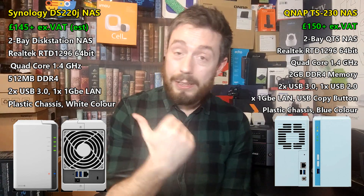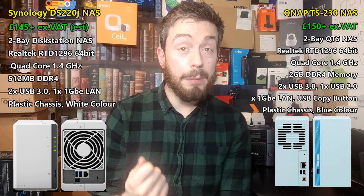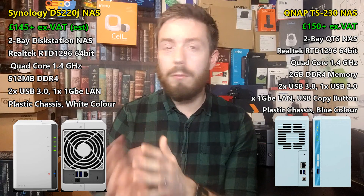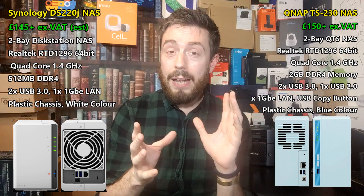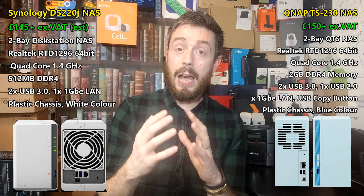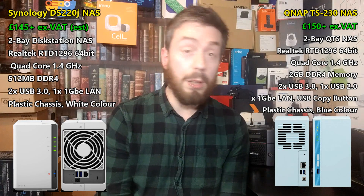The DS220J still feels old in terms of its hardware. I'm looking forward to doing the unboxing and software overview to learn more about it and just how well DSM will run on it — whether it's a full DSM 6.2.2 or a streamlined version like we saw on the DS119J. Remember, it still supports Synology Hybrid RAID, that wonderful fluid RAID system, and you've got access to all those great DSM applications. But for me right now, if you're buying for the software and it's just you accessing it, the 220J is probably fine. But if you want more growth, no low glass ceiling, and real value for money, the QNAP TS230 wins it in every other regard.